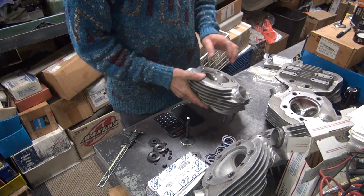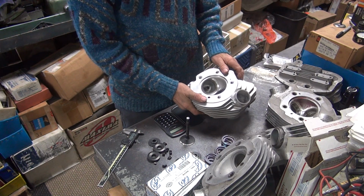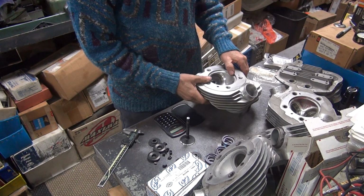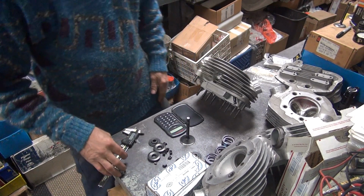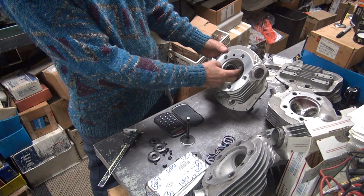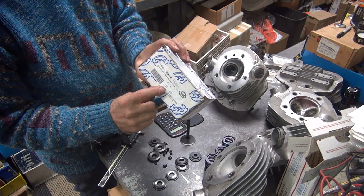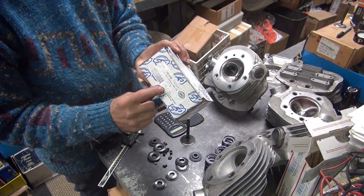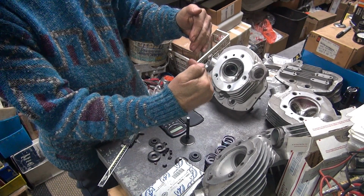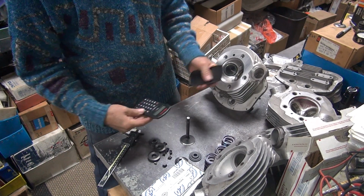So the higher the valves are on the head here, the better the flow will be out of both sides. And it also raises the compression. That makes it run better. So it's a plus. The negative is if they hit each other, if your TD is too high, you have a problem. See, your TD is low, you got 163, so you're down 20 thou, 25 thou from that. You gained a bunch of room when that sunk 25. So now the valves, instead of hitting each other, you're way down here. You got a lot of clearance. So it helps you a lot on this particular cam. If you go to a different cam, there are different numbers. Right, right.